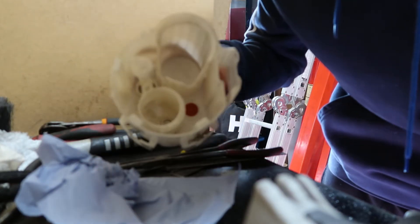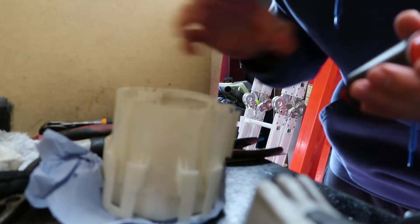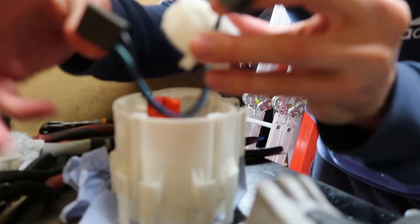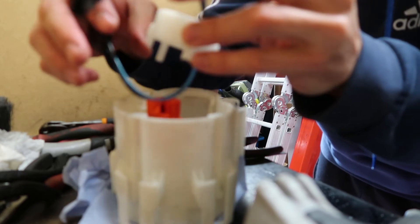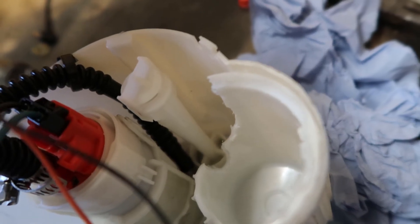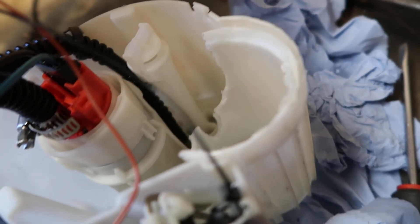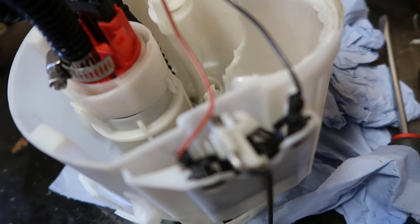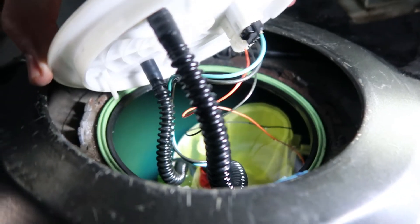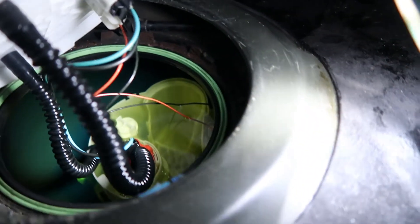If you were just doing a fuel pump change, then basically you just do it in the car - you don't need to take the basket out. Obviously I've taken it out and modified it. And that's the cap that you remove if you're doing it in the car, in the tank - just pull this cap off. Just send the unit back in, pump back together. And the return line just goes down to the bottom of the basket there. That's important - the return line goes in below the fuel level, otherwise you create bubbles and aeration which can cause lean outs and cavitation and problems, which you don't want. But yeah, we'll go put it back into the car. That's the basket back in - to put the lid back on and then basically just a reverse of what we've done to take it off.